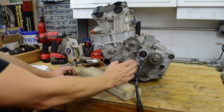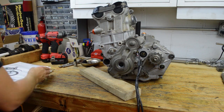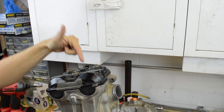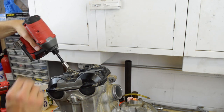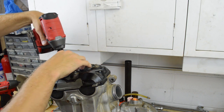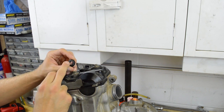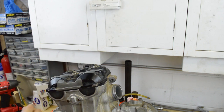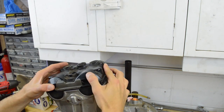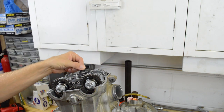Yeah, so first step, obviously drain the oil, make sure the oil's out of it, remove this cap, and let me get the camera pointed up here and we'll begin disassembly. All right, so you're gonna wanna blow some air in here to flush out any dirt or debris and remove the spark plug. Then take a 10 mil socket or impact or whatever and loosen all these three valve cover bolts. And there's a gasket under here. And this owner bought all new ones, so we'll replace that as well. Just three bolts for the valve cover. Then you're going to want to take that and the gasket off. And there's one more gasket here for the spark plug tube.